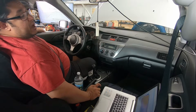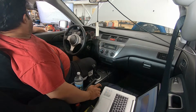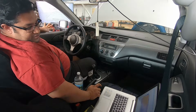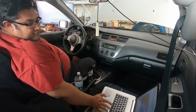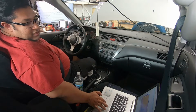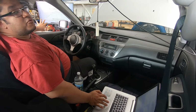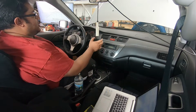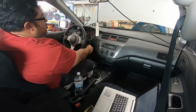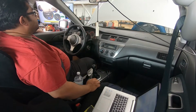That was at 22 pounds, running like 10.9 AFR, and we made like 319. I'm still dialing everything in, boost and fuel. It's a little easier on manual. You just click it and it does the same curve every time. But it's not as rewarding as it is on, I would say, electronic boost control. At least not to me.